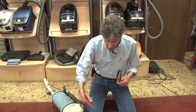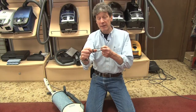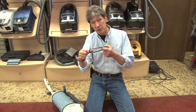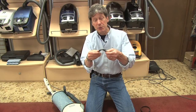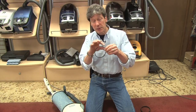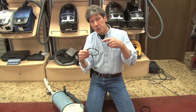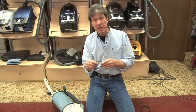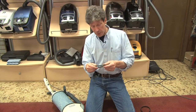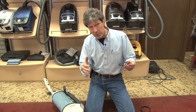While we're at this brush, we should mention that with most of our preferred vacuums, we do not have machines using rubber stretch belts — they stretch, they break, they need replacement. Rather, the belt used is a timing or cogged belt. It has teeth, it won't stretch, it won't slip, and the brush is spun at a constant functional speed. And if the brush head is jammed — say you go under a bed and pick up a t-shirt by mistake — it'll shut that brush down and protect the belt system.